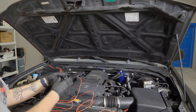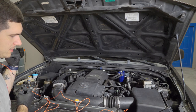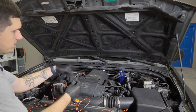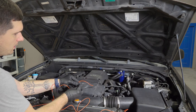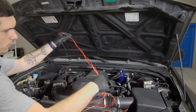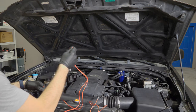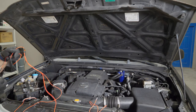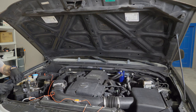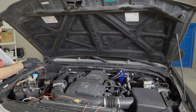Let's start today with some planning. I have my positive cable, and then of course the way to connect to the battery — it's already heat shrunk, the connection's already there, which is pretty awesome. We have our inline fuse already provided, and then we have our switch. From there, after the switch, it splits off and goes to each light, with connectors already in place. I'm just going to set this near the positive side of the battery and try not to let it touch the post.